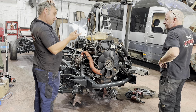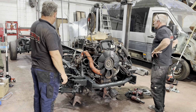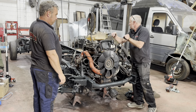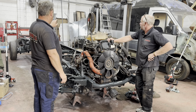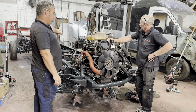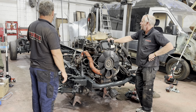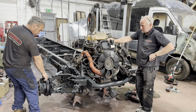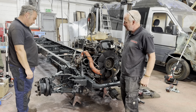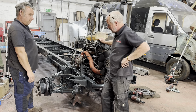Lift it right up, check underneath for any misses on the bottom and anything that needs scraping off. From the back we've had springs — they were a bit of an issue. The disc pads were done just before it came off the road, but we didn't have the brake backs because Iveco got them wrong. They've now given me the right brake backs, but it means I've taken it all back off again. I sheared all the bolts off for those — drilled all the holes out and doubly painted them so they don't rust like normal.